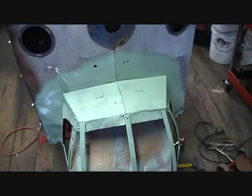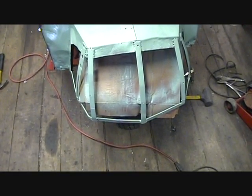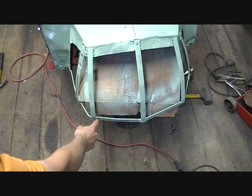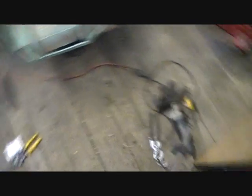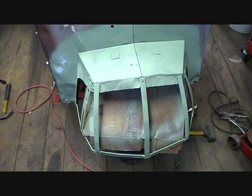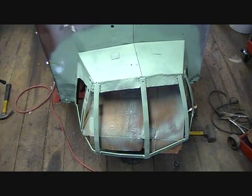Nice pretty green color that you're never ever going to see — I'm going to be covering this up with aluminum. What I did is I took the grinder, just like I did on the wheels, and ground off the rough parts of the weld. This part is a little rough, but it won't ever be shown through the final product. Then I took the wire brush and cleaned everything up. Primed it with the rusty metal primer, just because why not? And then I'm going to cover everything, including this little rust-through spot. The underside of this is rusty and would be very difficult to take care of at this time, so I'm going to end up sheathing the whole top of this in aluminum. Now on to putting on the aluminum.